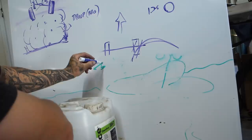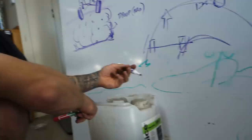So the Ackerman is the thing that you want with either A-arms or beams to be proper. When you take a junkyard beam setup, the only thing that's tricky to overcome is going from a rear steer, older style beam end that's much stronger, to front steer, and then overcoming this. But it's simple stuff, again. It's been done 100 times, thousands of different ways, and it's super simple. And still, at the end of the day, cheaper and easier to overcome than A-arms, which are very evil, okay? Yep, bad stuff. They're the devil. It's just science. If you have A-arms, you're cheating. No, I'm just kidding. UTVs have A-arms and they're really cool.